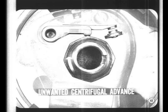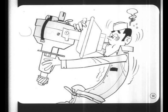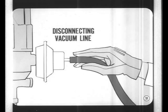If the diaphragm in the vacuum advance unit is punctured, both economy and performance will suffer. To test the diaphragm, apply vacuum to the advance unit — the easiest check is to apply mouth suction to the inlet and see if the diaphragm moves the breaker plate and holds without leaking. Be careful when disconnecting or connecting the vacuum advance line: a careless yank or push can spring things enough to affect the calibration of the vacuum advance unit.